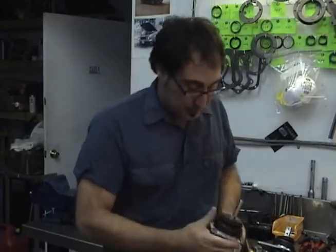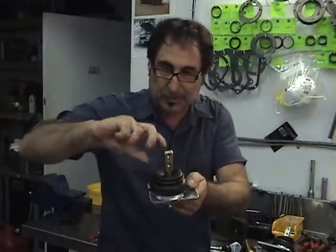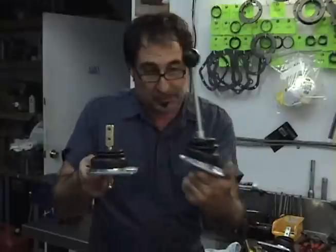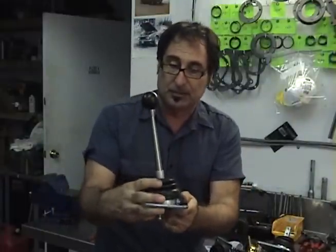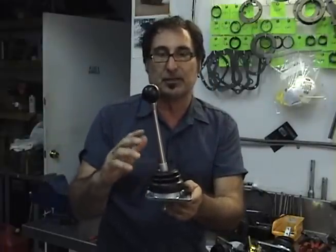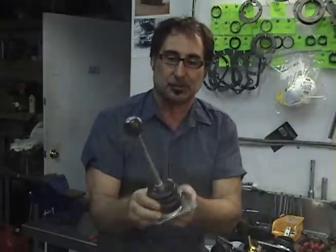What I'm going to teach you today is how to take something like this, which has maybe a bolt-on stick. What people do is they may bolt something on or weld something and add it, and it really looks kind of chintzy and not really professional. So we're going to take something like this and turn it into something like this — a nice compact little shifter we make for Jaguars. By creating a shifter like this, you also give the transmission a better shift feel rather than having some weird offset levers welded or bolted on. This gives you a really nice positive feel, and it's very trick looking.